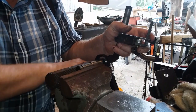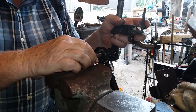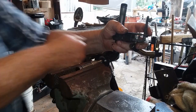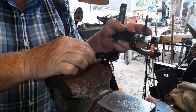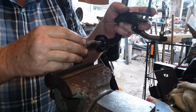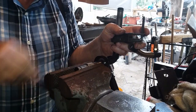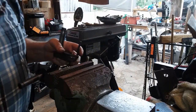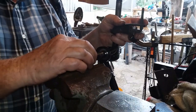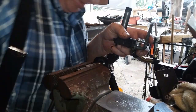Here I'm using the kingpin and the bushing to resolve my problem. Notice I'm cranking really hard on that vise — the jaws have a coarse knurled surface, lots of bumps all over it. That's perfect for what I want to do, because I want to make small indentations into the bushing. Those indentations are not just on the outside — they push the metal so they're on the inside as well, just a little bit. That's what you want, so when you put the bushing back into the axle sleeve it'll compress and be a tight fit. Now this is the second bushing — basically the same thing.